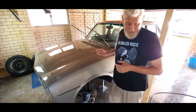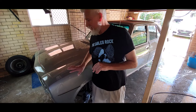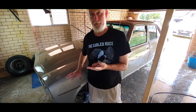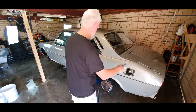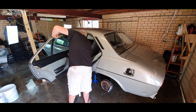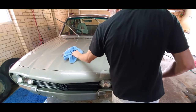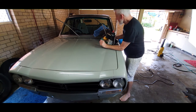A thousand percent better — I love clay bar, it's an amazing product. We'll dry the car again. I'm using the compressor here to get the last remaining dribbles of water out of those little hooks and crannies so it doesn't run into the cutting compound. I'm going to do one light cut — not going to go stupid with it. We'll see how the paint responds, whether I'm lifting too much off or any colour comes out, then maybe one pad cut, one pad polish.